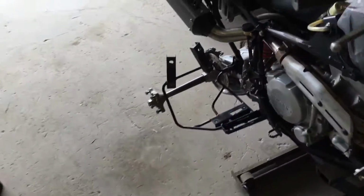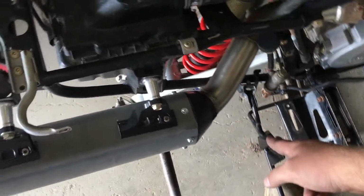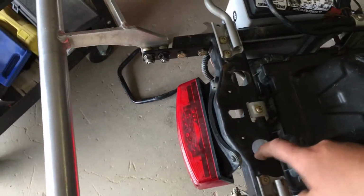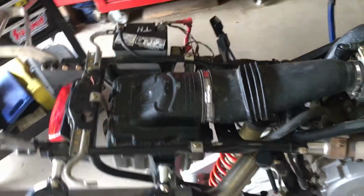For the rear, it's very simple. Remove these 2 bolts, 2 bolts back here, 2 bolts here and there, and then 2 grommets will be stuck through. You take them off, and then the 2 bolts on that side as well. And then the whole back plastic comes off. And then you have this.